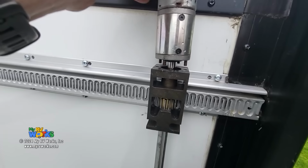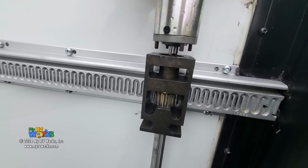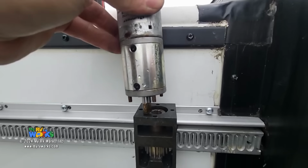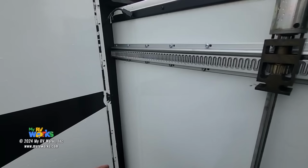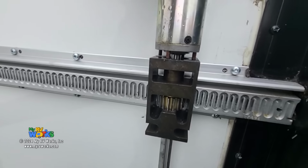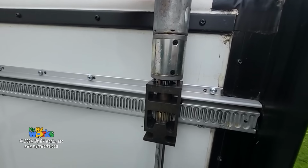Okay, so our motor is going to be in here, and we're not able to get this motor to seat. Okay, well, there's that little D profile on the end of the motor you're trying to fight, and sometimes it's easier just to take these H columns out. If all you got to do is take a whole bunch of screws off and the thing pops out, sometimes it's just a lot easier to do that. I'm serious, guys. It's a lot easier to do that than to have to deal with a little slot they give you on the inside where you're just fighting it.